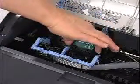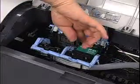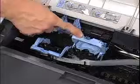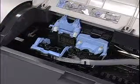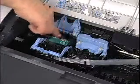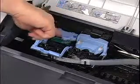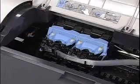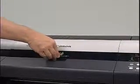With the nozzles facing down and the metal contacts toward the back, insert each printhead into the carriage. Push down firmly and close the printhead levers and covers to lock each printhead firmly into place. Once the printheads are properly installed, you will be prompted to close the top cover.